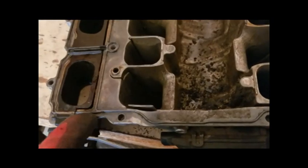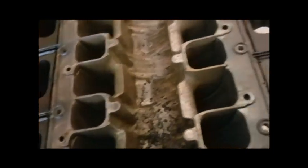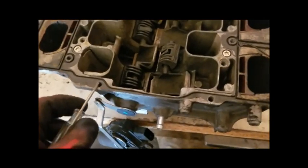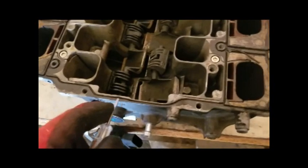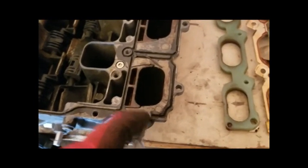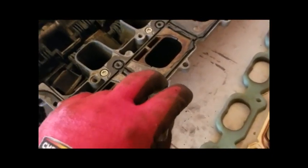This is the bottom, and when you're resealing the intake manifold, you want to walk around that ledge after you've done all your work and reseal it. This is where you want to start because you're able to get your screwdriver in here the furthest. If you try to put your screwdriver in anywhere else, you're going to keep hitting this ledge and you're not going to be able to get in very far. Even on the sides it's the same thing — you're going to be running into this lip. If you get too aggressive, that's when you end up breaking stuff.